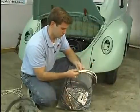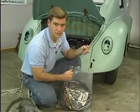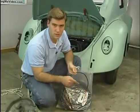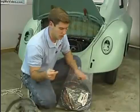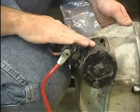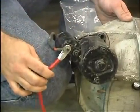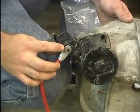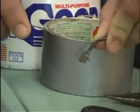The first wire we're going to be putting on is this thick red wire with black insulation. This is the one that runs between the starter and the voltage regulator, which is on top of our generator on this car. It's got a small eyelet on one end, which is what goes through the voltage regulator, the back of the solenoid on the starter, and the same post that has our battery cable. It's held on by a 13-millimeter nut and a washer. I'll go ahead and show you on a piece of scrap wire how that loops over.